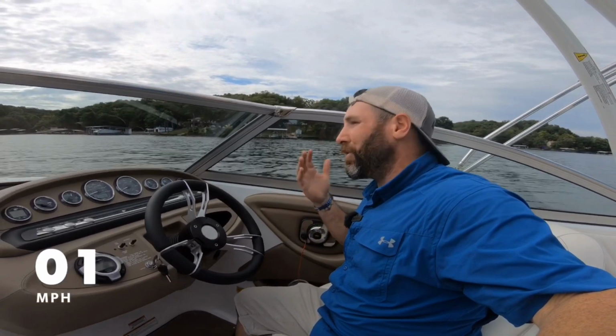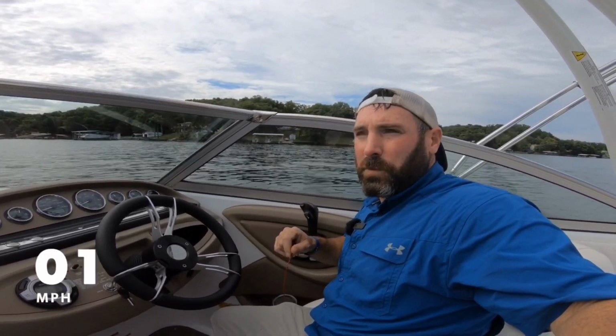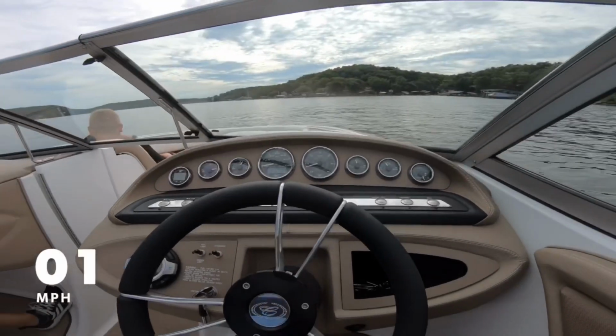But for water sports, light cruising, anything that you're essentially doing at about 30 miles an hour or under, really 25 and under, there's no reason to touch trim. Only touch the trim when you're putting it on the trailer, when you're going that slow. So now that we understand that, that's your visual trim gauge, we're going to do the water sports speed first. Dead stop here.